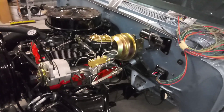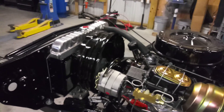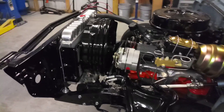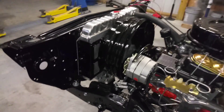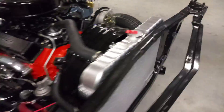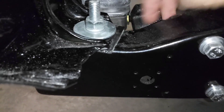I got my radiator earlier this week and mounted it. I'm debating on painting the top side black or not — I just kind of threw it on there today, but it doesn't really look that bad with the raw aluminum. I had to drill out the bottom mount on both sides and notch it over here — this is a three-row aluminum radiator. I had to notch right there to clear the radiator support. It clears the 500 gearbox really well with plenty of room.